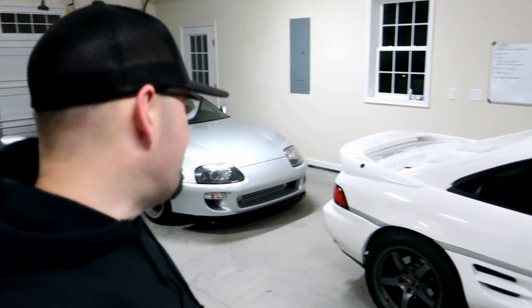So as you guys saw in the last video, I was having a ton of issues with this bad boy right here. It wasn't too happy. If you saw the last video, the brakes were a major issue. The powder coater really messed up, plain and simple. They had a ton of grit. When they were sandblasting, they left all the sand and stuff in the brakes. I had to clear them out, and all the bleeders were caked, and I mean caked full.